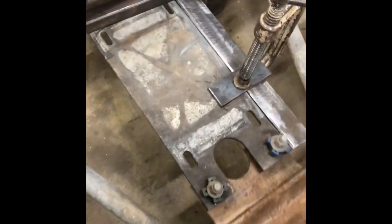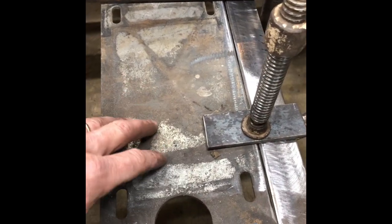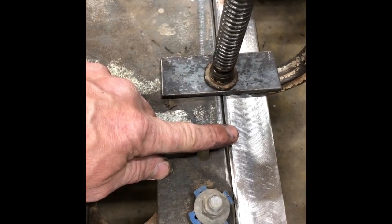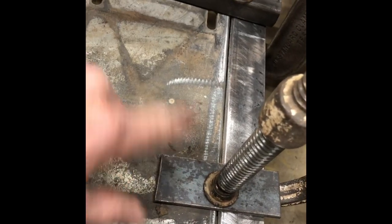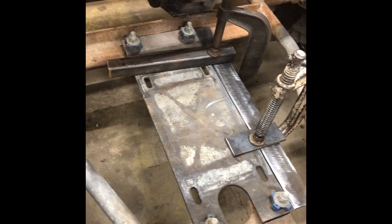I set my engine in place and it doesn't line up with these holes, which I assumed would happen. The whole engine sits over to the driver's side. I had this piece of quarter inch by inch-and-a-half steel — same thickness as the plate. So I beveled both pieces, clamped it on there, left a little gap, and I'm going to tack weld it. I'll set the engine down, mark exactly where it goes, pull that piece out, finish welding it, and drill it at that time. Easier to put it on the drill press.